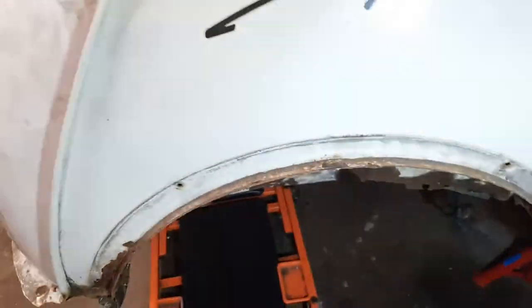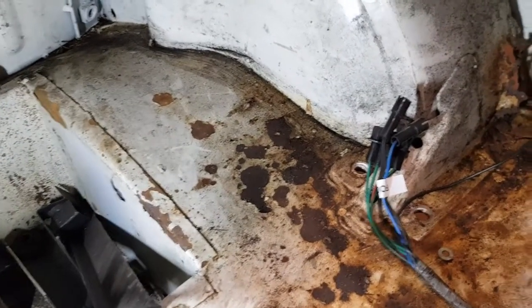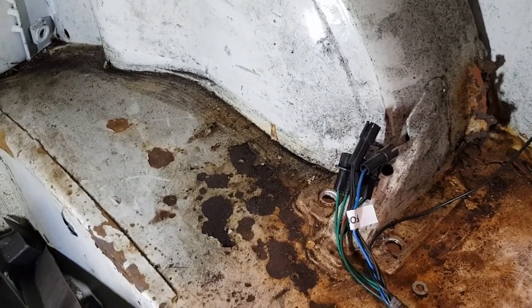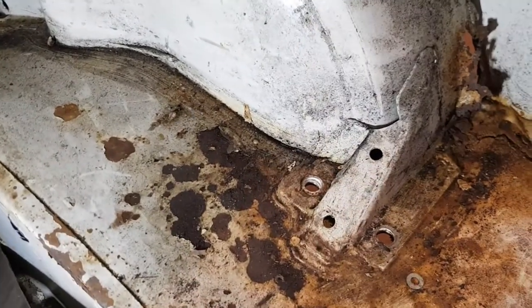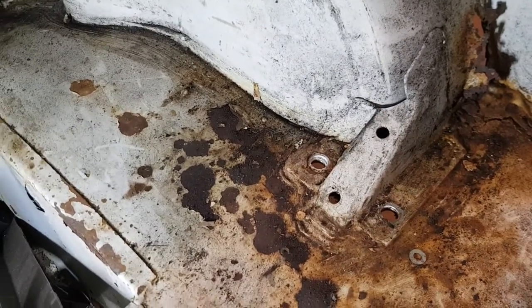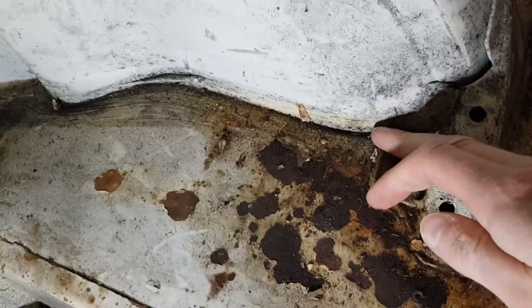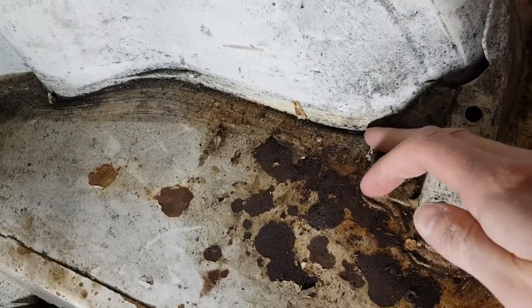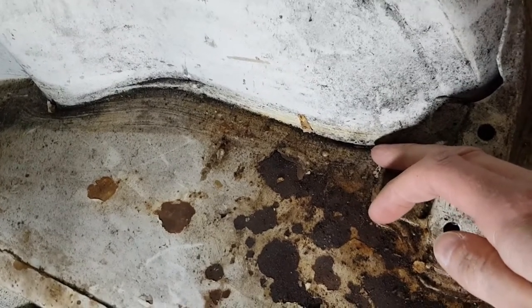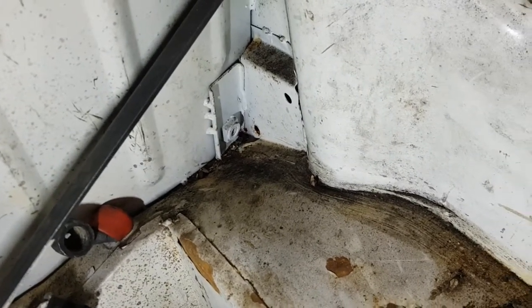The job today is to start removing that. Looking from inside the boot, it's going to be a case of cutting out using a combination of the grinder and the air saw all the way around. I don't think it's actually welded on that edge - I think that's seam sealed - and then the weld is like a return on the floor and then welded on the flange. I need to cut around the subframe bracket and the seat belt bracket.